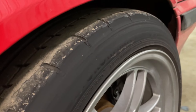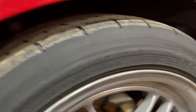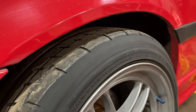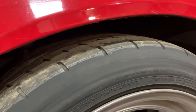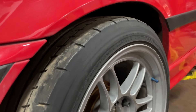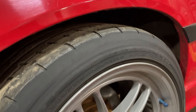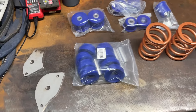That's what it looks like right now. Here's the other side — this side's probably a little worse. But yeah, you get the idea: more spring, less body roll. If it still happens, I'll probably roll the fenders more or get a stiffer sway bar and see if that takes care of the issue. Here's what I'm working with today.